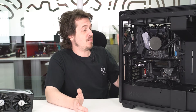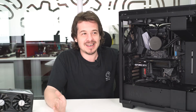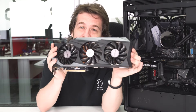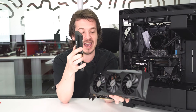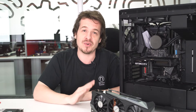And just like that, that's how you fit a graphics card — this machine is now ready to play games. But this is a game capture rig, and while the 3050 is an excellent entry-level card for esports and 1080p gaming, it's not quite enough. We need to get 4K footage for YouTube. So today we're fitting our 3090 by Gigabyte — a sufficiently bigger card — and I'll go into detail on fitting bigger cards like that. We also have a capture card to fit, which gives you an idea of what it's like fitting multiple PCI devices. And I want to show you the proper spacing to make sure our card has the right airflow and stays cool.